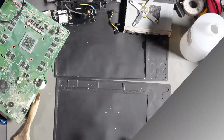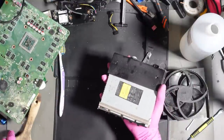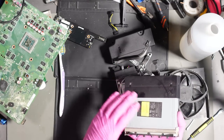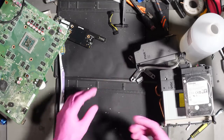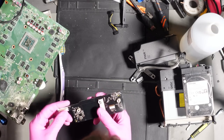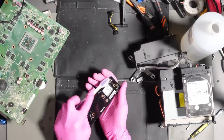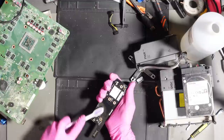I'll just brush this off away from the desk. There we go — that's the fan. I'll continue to do the other components. So they were not too bad. I don't really have any concerns about the disc drive because the disc drive appeared to work. The main concern really is that the sync button isn't working. I believe that might be down to just a little bit of liquid damage on the sync button, so I'm going to give it a clean with isopropyl alcohol.